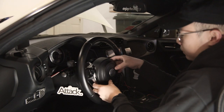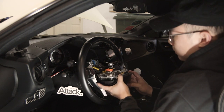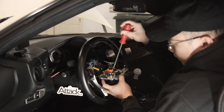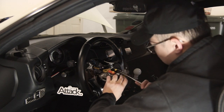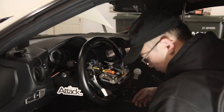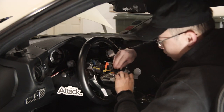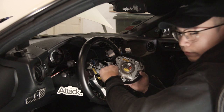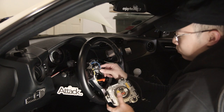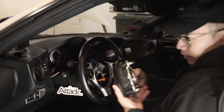Once all those clips are released, you can see your airbag will pop off. Be really careful not to yank these wires out because you're going to mess up your clock spring. Try not to screw around with that too much. You take a flat head and pry up on these connectors — once they pop off, they'll pop off like so. And then you have your horn ground wire, so you just got to pull that off. Also disconnect this white part up here as well. Now the airbag's off.